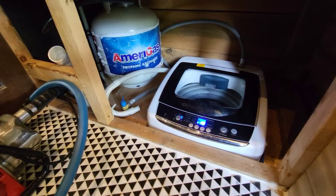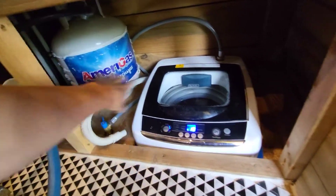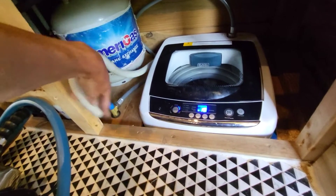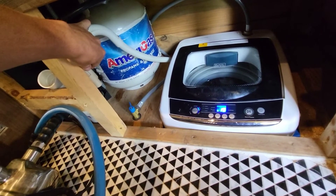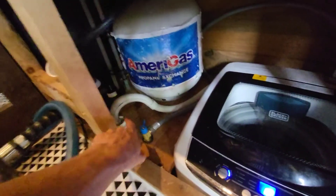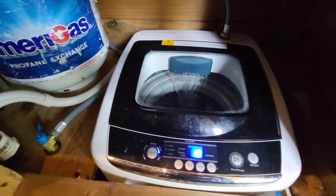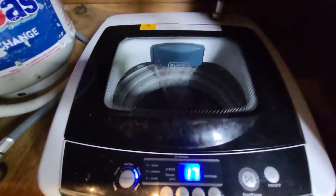So I had the washing machine running and I didn't realize that you need to have the drain higher than the washing machine, or else it just continuously drains out. So don't make the same mistake I did — make sure your drain goes up before it goes back down again. I'm going to add the drain going through that same hole. Now we're filling again. What was happening before is it was just draining straight out, so now it should fill up to the correct water level and then be pumped up and out instead of just gravity-feeding out.